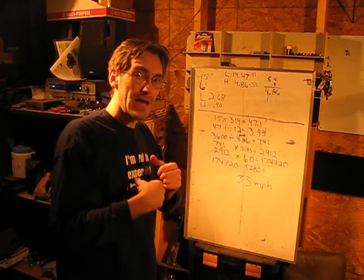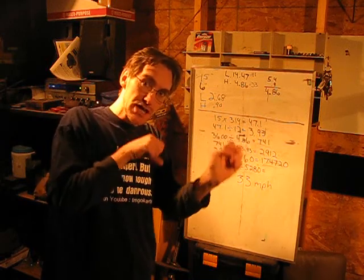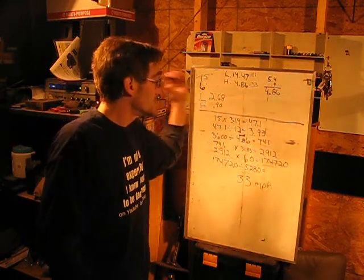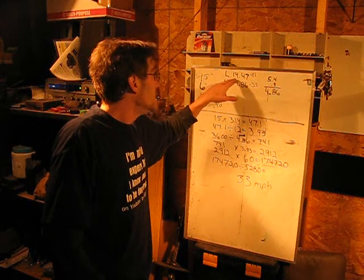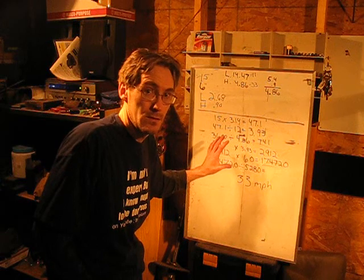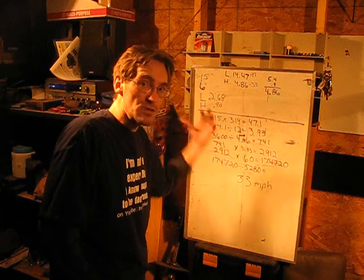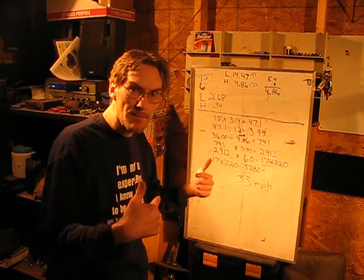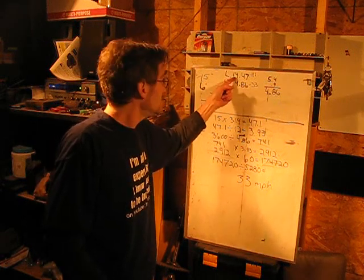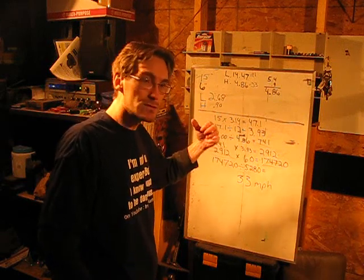Now, if I were to swap that out, take out the clutch and the sprockets off of the jack shaft and replace that with a torque converter with a 6-inch driver, the Chinese model one that I've got, then I would know this entire ratio right here is what her go-kart would be able to do. She would have a 14.47, which means that the moment she gives it gas, boom, she'd be ripping it up. Because as it is now, it's only at a 10.8. If I were to change it, it'd be a 14.47, which means it's a lot more rotation, but there's going to be a lot of power behind those wheels.